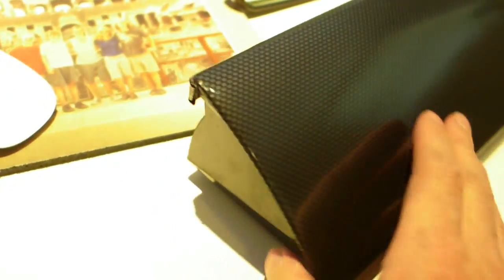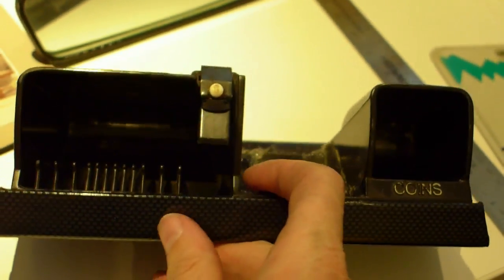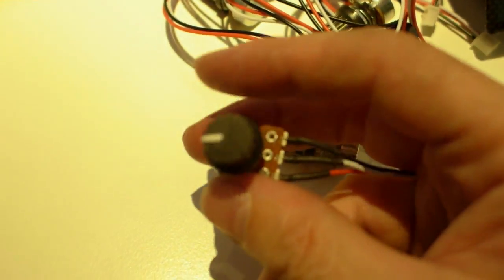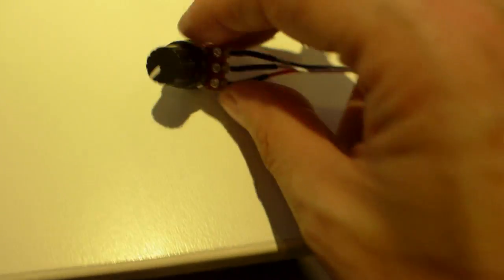The last owner did this faux carbon fiber treatment on the glove box. What I'm going to do is mount a bunch of switches on this side here. I'll show you — I've got eBay potentiometers, six for six dollars fresh from Hong Kong, that are going to be the seat heater controls — variable between zero and a hundred percent for the two seat heaters.